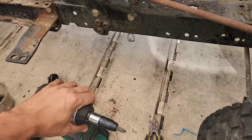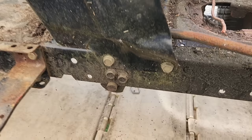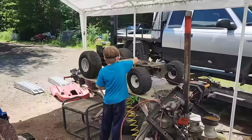Today's episode of what should work versus what actually works: what should work on getting the steering column out is one of these large impact Phillips bits on the bottom. What actually works is a good set of vice grips held right on, and have somebody twist the steering wheel while you're holding it.